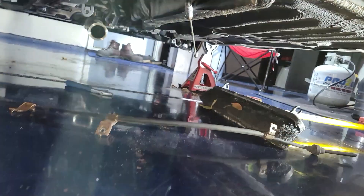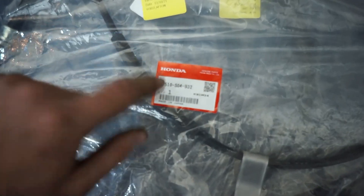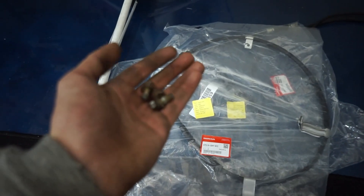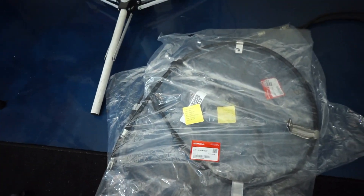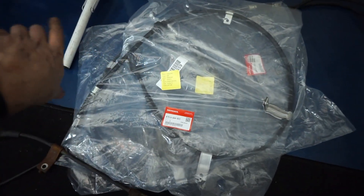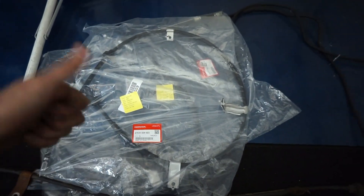That's one of them out. Now that we've got the old crusty passenger side e-brake cable out, we can go ahead and install the new OEM Civic Si e-brake cable. I'll have the part number and all part numbers in the description below. I'll go ahead and reuse the factory hardware — there's a little bit of surface rust on it but the threads still look really good, so I'll just put a little more anti-seize on the threads. Pretty much reverse the process we used to pull it out, snaking it through the same routing through the trailing arm. The brackets are all brand new so that'll be really nice. I'll throw it on time-lapse and catch up when I'm all done.